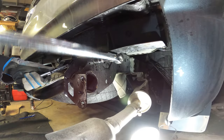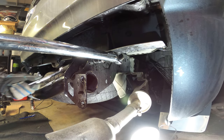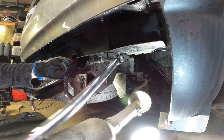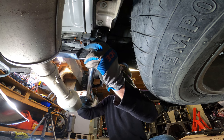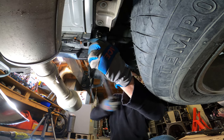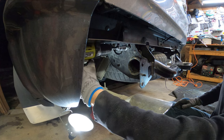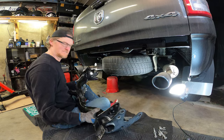There are four large bolts holding each side to the frame rail. I thought I needed to hold the nut on the backside of the bolts, but no — they are welded into place. Just break the bolts loose and remove them from both sides. I used a drill with a socket adapter to make it quicker, and again I thought it would fall but it held itself in place. Slide it backward and it comes out.